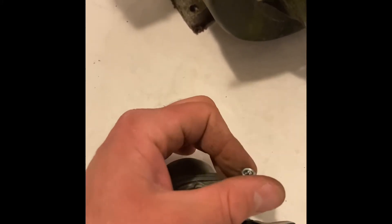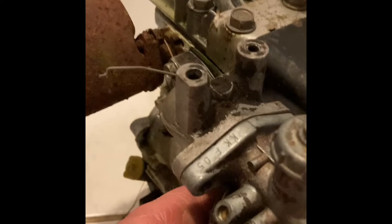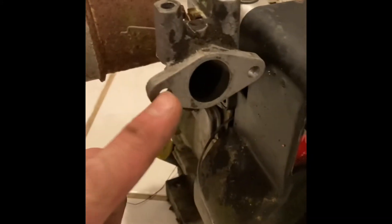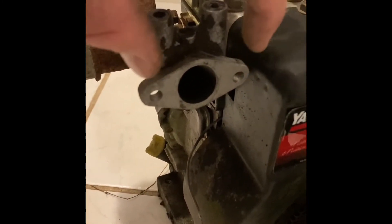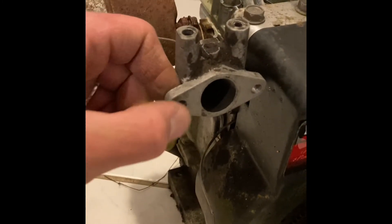These thread in — these are M10 bolts. It's going to go up there, and look at the fit. I mean, it is like a glove. There's one thing you need to do though: you've got to drill out these holes a little bit to make them a little bigger, because it's just a little too skinny here and it needs to be a little bit wider to match up with this. That's all you've got to do.